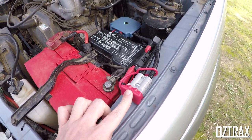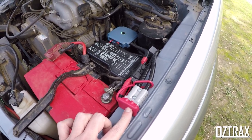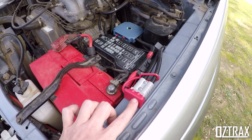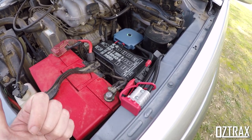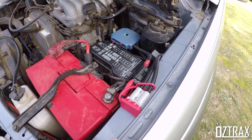I gave it a bit of a test run over the weekend. The battery fully charged with the fridge running during the day, not a problem. I only used 0.1 of a volt overnight. It was a 6-degree night so the fridge wasn't cycling too much. That's my recent update — I'll cut in some footage to show you the SBI 12 setup originally.